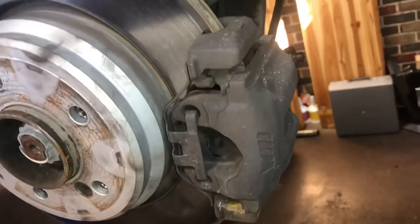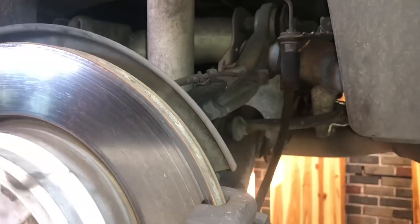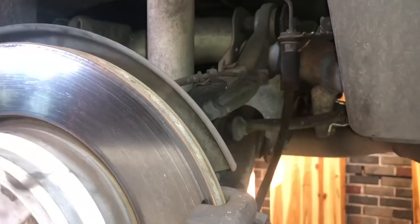So there's that ruined brake line. My whole plan here is to rip the anti-rattle clip off, pull the little boots off of our 7mm slide pins, then take my 7mm Allen and back those pins off, and then compress the caliper just a little bit. By doing that I should be able to pull the caliper off, and then I can loosen up these lines and actually twist the caliper off the line, making sure nothing gets super bent up. I'm going to grab a towel or a jug to put on the ground because this is going to make a bit of a mess. These lines are sure toast.